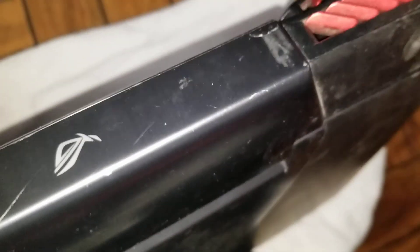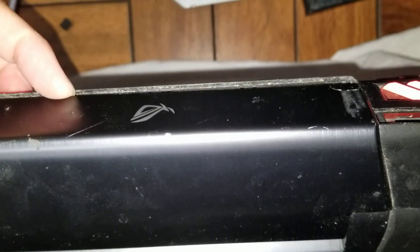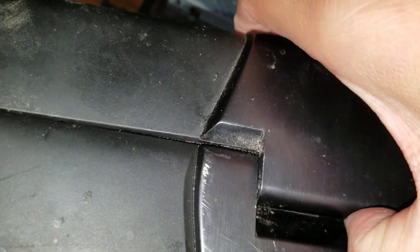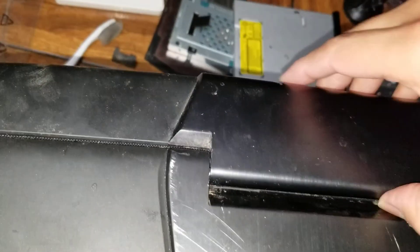Once you've removed all the screws, flip the laptop over. On the back, there's a panel piece that comes out. Get between the layer and pull on it, going around the sides. Be careful because there's a wire underneath. This part goes all the way down here. Just kind of pull and wiggle it — remember to be careful because there's a cable connected for the speakers underneath this panel. It gets stuck because there are longer bits of plastic protruding that can get caught.